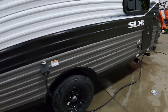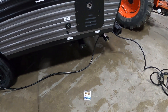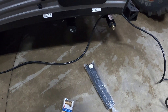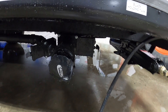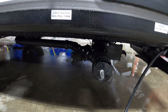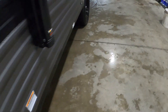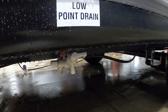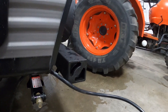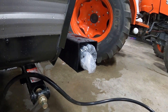If we are at a campsite, we're going to unhook our power, our water, our cable, bring up our stabilizer jacks, and head up to the dump station. At the dump station, park accordingly — your dump is going to be right behind the rear of the unit. A 10-foot hose comes in your convenience pack. Hook that up and pull your black tank handle to let out your sewage. Go inside and look to see if your black is empty. If it shows empty, come back out, close that black, and pull your gray handle. While your grays are draining, come around and dump your low point drains. Then close that gray, take your sewage hose, and store it in your bumper — the stinky slinky — and head on home.